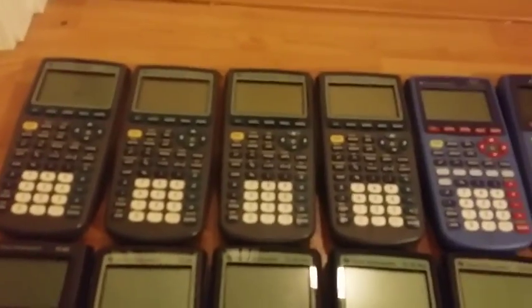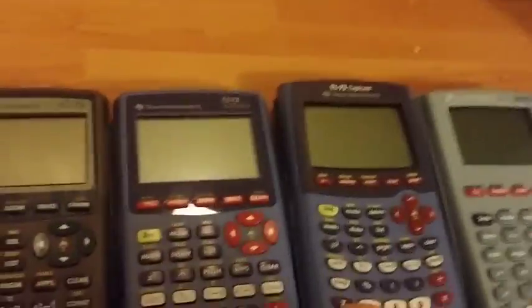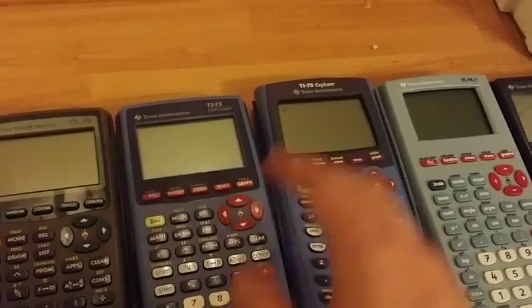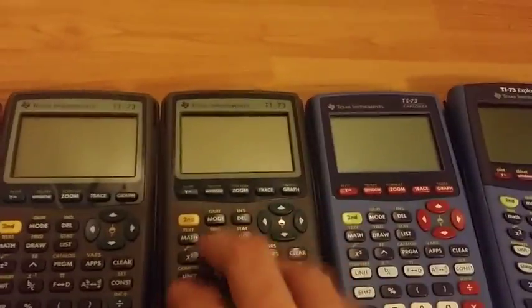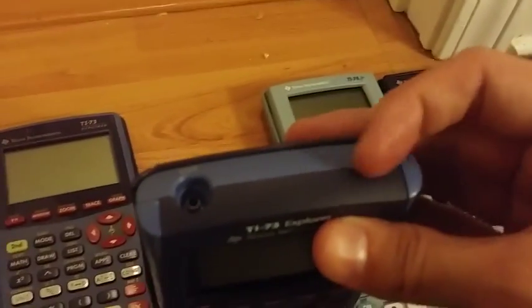There are six TI-73s here. Four are regular old TI-73s. The first one has boot code version 1.3004, which is the oldest. Most of them normally have 1.3005, and the latest here has what I believe is the latest, which is 1.3007. These two, despite being blue, are exactly the same as the others — they just added 'Explorer' to the name, so it's TI-73 Explorer instead of TI-73. This one has the 83 Plus style case, this one has the 84 Plus style molding, except it doesn't have a USB port, and the link port is at the bottom like any other calculator.